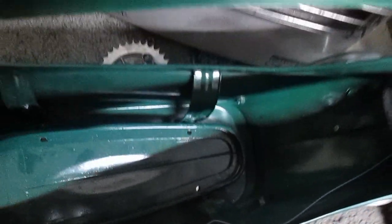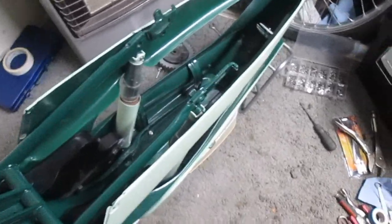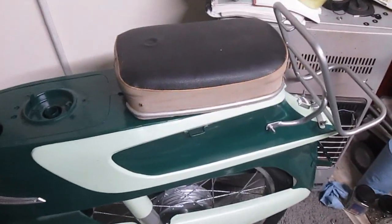The rear seat bolts through those four holes. I've also put in this bolt here that goes right through and comes out through the other side of the frame. Finally I've got the rear seat on — I had to jig around the holes and re-drill them a bit to help the bolts go through, but I've assembled them with 6mm bolts, spring washers, and washers. Now I can install the rear wheel — I've got the rear wheel on and the rear seat is on.